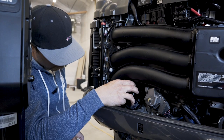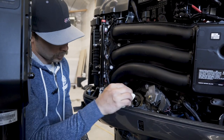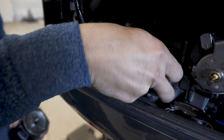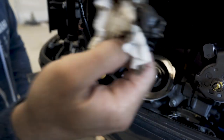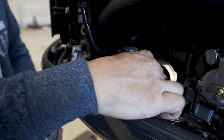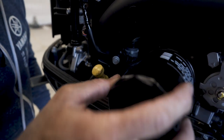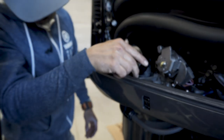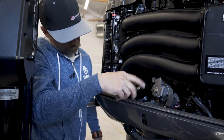Replace with the new filter. There's a little cup right here that's going to collect a bunch of that oil — you can take a paper towel and soak a bunch of that up, or it'll just drain down into the oil cavity. But if you've got something to clean it up with, you might as well, and then screw the new filter right back on.